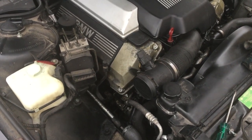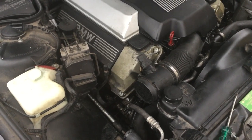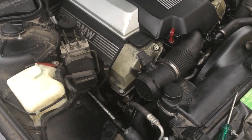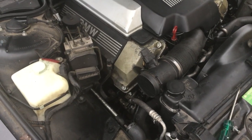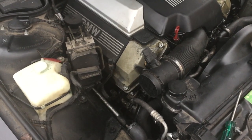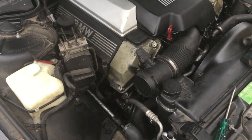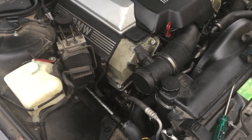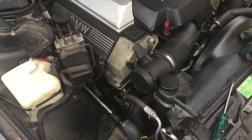Install it. Don't over-tighten it — it doesn't have to be super tight. Put the air box back in and start the car, let it idle for a minute or so so the oil pressure builds up. That way the tensioner starts pushing on the guides.